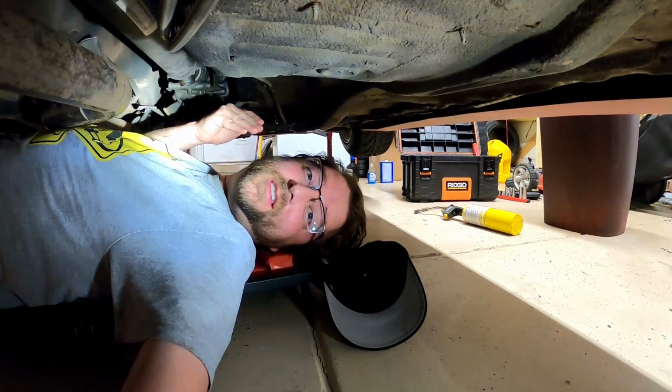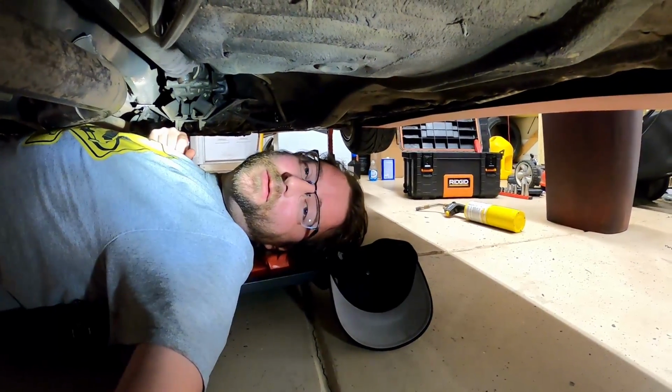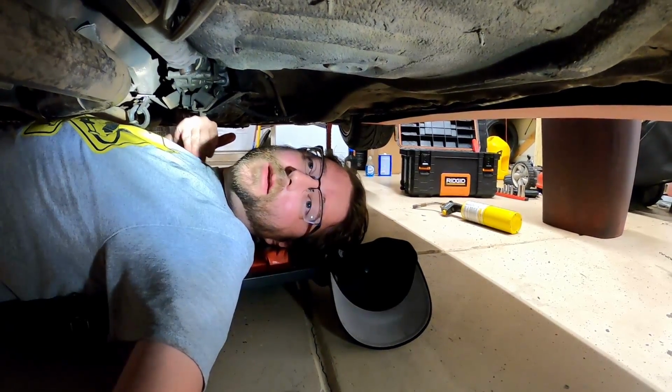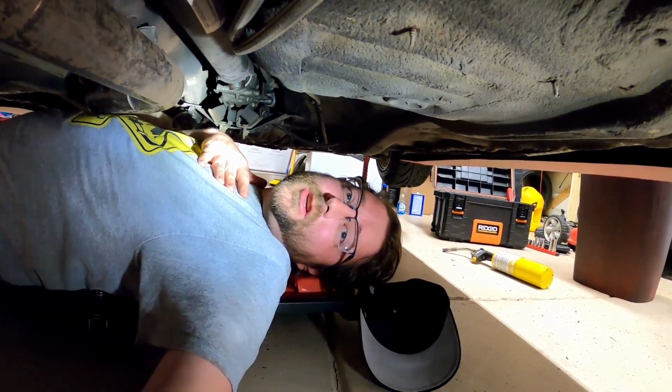If you don't have it set up correctly for vibration, I've seen a couple of cars that actually had the tail shaft housing of the transmission explode. I've also seen one where the drive shaft ended up twisting and it ripped out the fuel lines and the brake lines, which is a really big deal because it's a really, really tight fit in here between the drive shaft and my fuel lines, and I really don't want to rip those out. So, 1-piece versus 2-piece drive shaft, that's all you need to know.